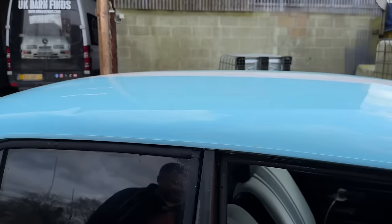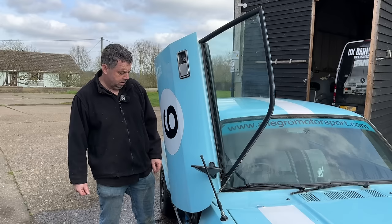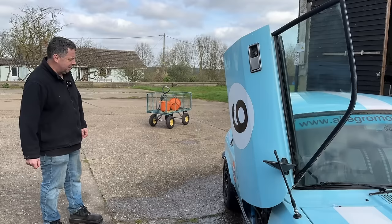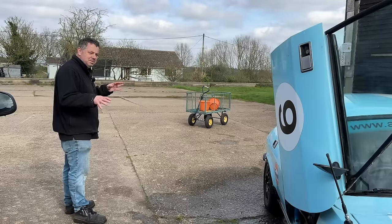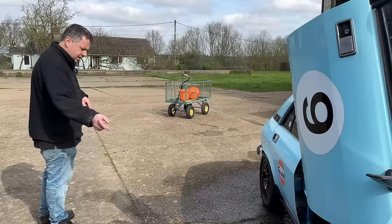If we could work out a way, to be honest, shouldn't be that hard, to open it from the outside in case of emergency. And then, yeah, that will be one hurdle overcome. We've already found another with that pipe. Yeah, on that note, does anyone in the comments know where we can get a replacement pipe? I think the spheres may be okay. Right. But until the pipe's done, we won't know for sure, because normally the spheres go as well. But yeah, we could do with, that's a 1500 Spec LE, and we need the offside hydrolastic pipe, whatever they call that.